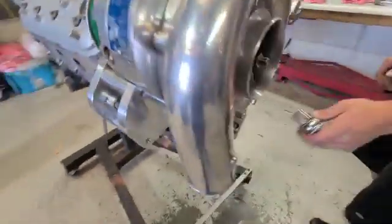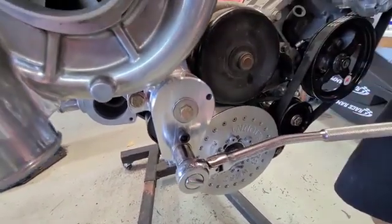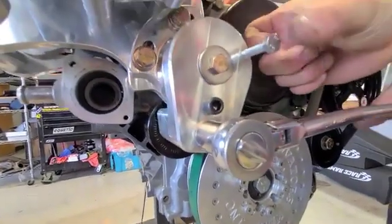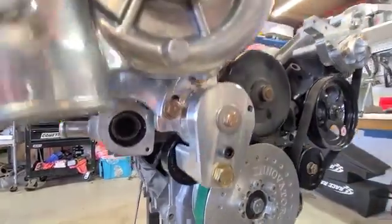These thread into aluminum, so you don't have to get crazy with them. Now go back to the bottom — from under the car, remove your tensioner locking bolt. The pre-loaded tensioner now has the ability to travel both directions, but right now it's pre-loaded because you've got the top swing tight.